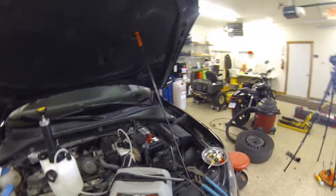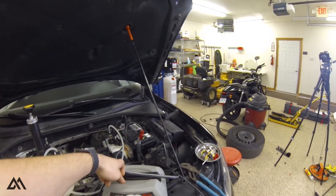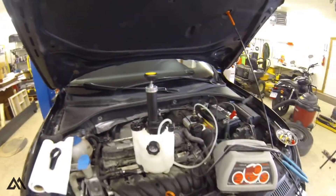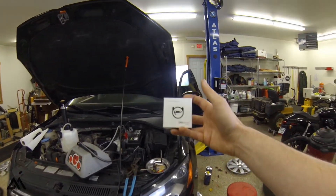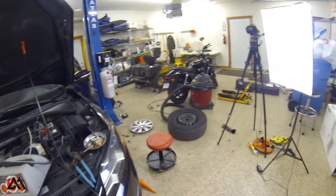Since we are going to have to have the car in auxiliary to use this tool, we're going to want to put the car on a battery charger so that the voltage doesn't drop. If it does, some of the functions that we get with this will stop working. I've also got the power bleeder hooked up here. I will probably be bleeding between 15 and 20 PSI — I've done 20 before and the whole system holds up just fine. But first we've got to plug this in and connect to the vehicle, so I'm going to go ahead and start the battery charger.